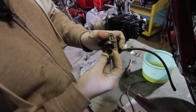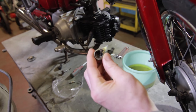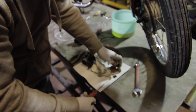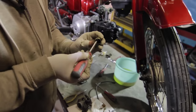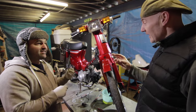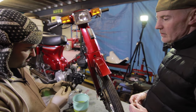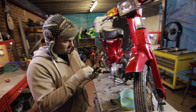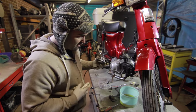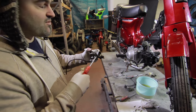Look at that — oh wow, that is monster bad. That is some serious chatola right there. Honestly, I've seen thinner marmite. That is all wrong. With an inline fuel filter in you can see this happening — you can't see the build-up otherwise. You just pull it off and put another one on. The carb body is actually quite clean — people clean them in parts washers or ultrasonic cleaners. I'll just give it a blow off, blow all the little holes out — these are where air and fuel pass through.